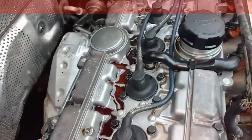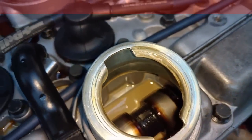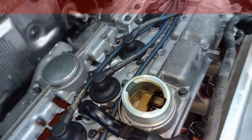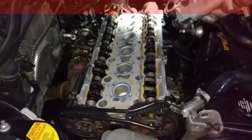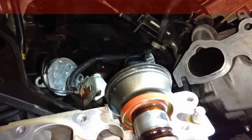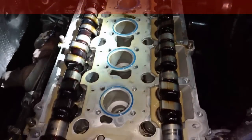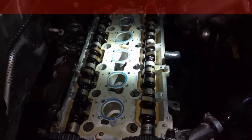You normally don't see this much oil on top, which looks funny. But when you look down in that hole — look at that. That's some creamy coffee right there. Whoever put this head on did not put any kind of sealing on the cam cover. I don't know how this car ever ran without spewing oil everywhere. And somehow he got the rotor dust cap locked inside the cam — that's a new one on me. So we're about to lift these cams out of the head and break these head bolts loose and work this head out of here.